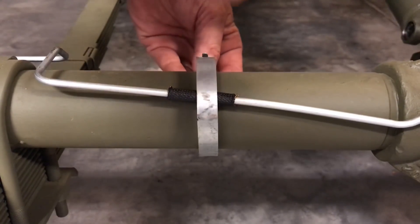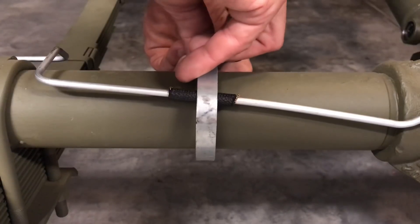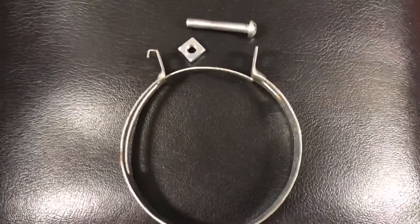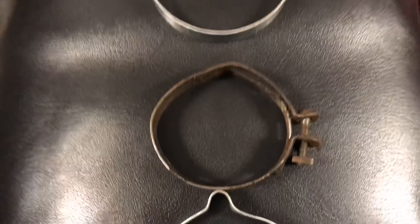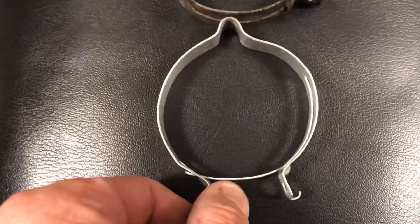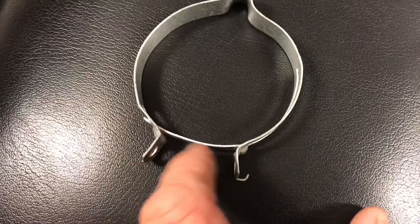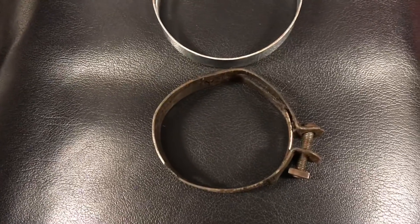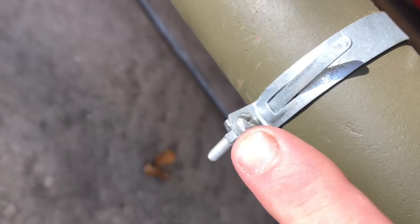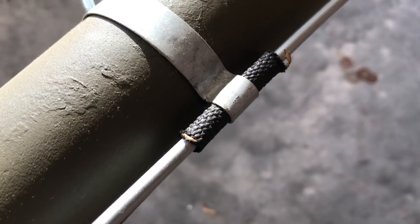The clamp that holds the brake line to the axle tube is located in the center of the tube and goes over the top of a piece of cotton loom, held in place with a screw. The reproduction clamps are the same design as the originals but slightly too large in diameter. My solution: using needle-nose pliers, I made a small loop across from the screw location — this acts as a standoff, keeping the line away from the tube. If you're after a factory-correct Jeep, you'll need to locate and use the original clamp. I installed the clamp with the screw facing the front of the Jeep and the tongue facing upward, centered on the asphalt loom.